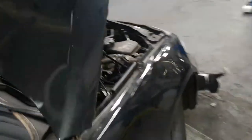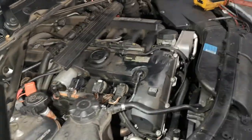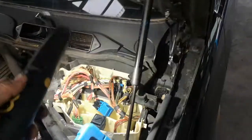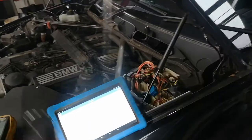This car was whistling very strongly through the PCV system — it's now not there. Basically maybe the valvetronic being stuck in the 64 degree position made the PCV whistle with an internal vacuum, because now it's gone. What this video is about: DME internal fault — go straight to your battery and your wiring. Check this relay and that fuse. Fuses just don't blow on their own — I sent the customer a message at 7am asking if anyone had shorted anything. Anyway, that's all sorted — hope that helps, bye.